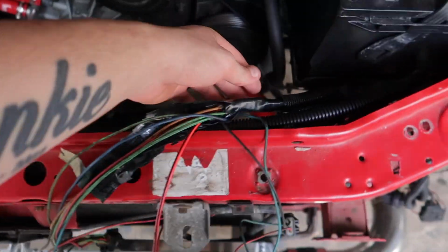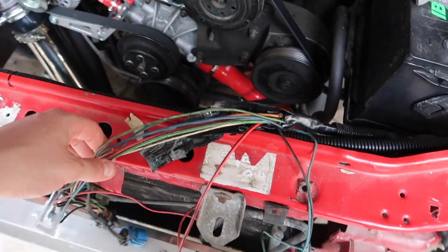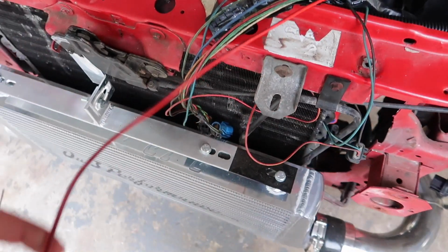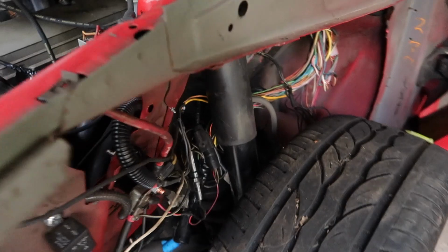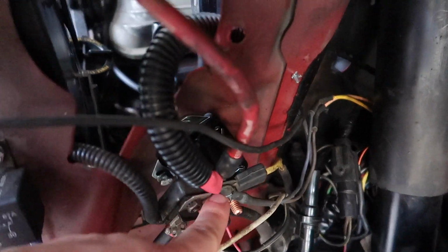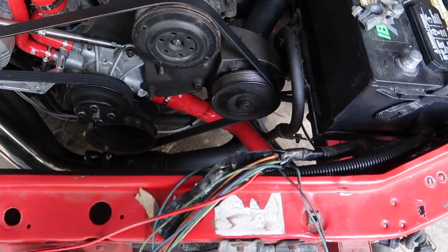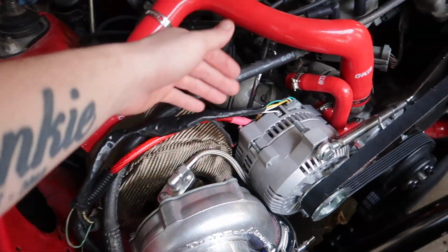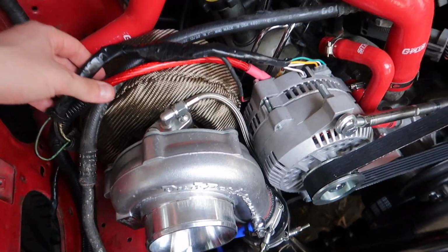Because I had to redo this wire to find the problem, I'm rewrapping it. I ran out of electrical tape, so I've got to go get some. Then I'm going to put a ring terminal on the end of this to go onto the accessory post on the starter relay. I keep looking everywhere, and I don't think the yellow and white wire was running to any type of fuse or fusible link, so we don't have to worry about that. With that, obviously, I cleaned this up and tried to make it a little bit better.